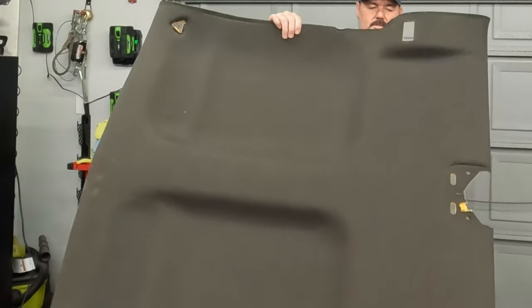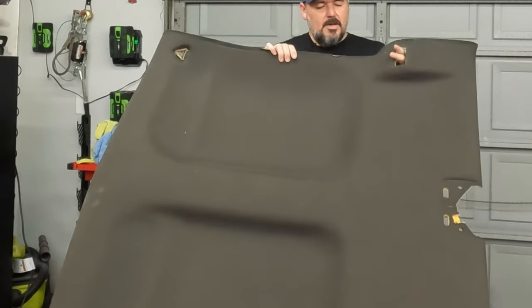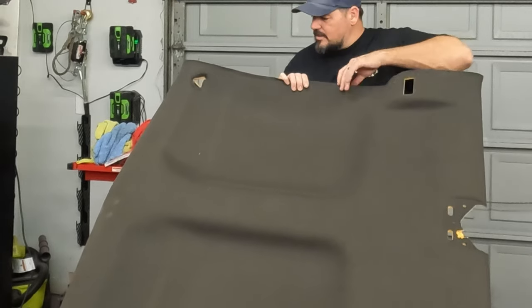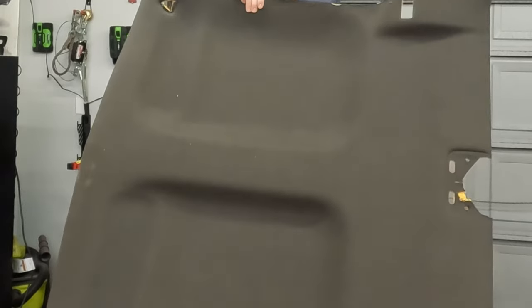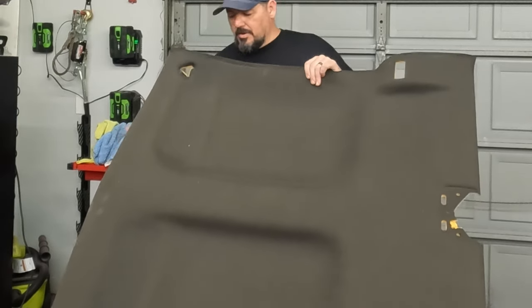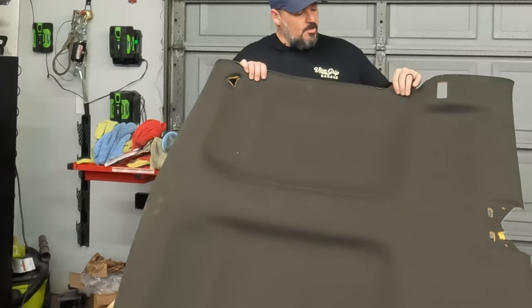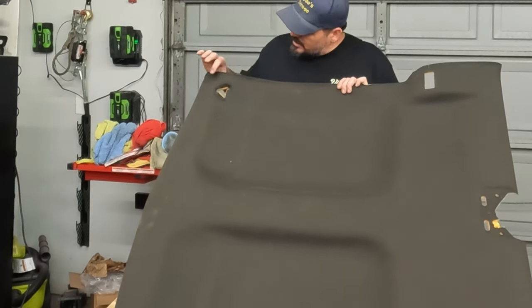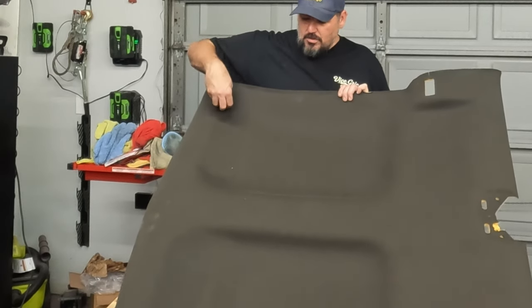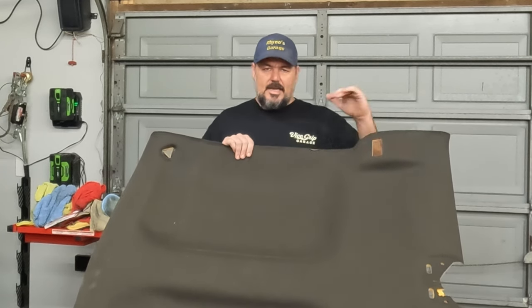You can kind of see by looking at it where the connection points are. These are the seat belt holes — this is the rear, this is the front. The rear seat belt shoulder harnesses go through here. This is where your dome light is, and this is where the visors go. It's held up pretty much by the visors, some Velcro on the back, and all of the trim pieces — the A-pillars, the part that comes up across the top of the door, and the rear trim piece that comes up in the rear seat. The visors screw through this hole, and those visor brackets hold it up front while the dome light holds it in the back. They're not terribly complicated — the hardest part is getting them in and out without breaking them.